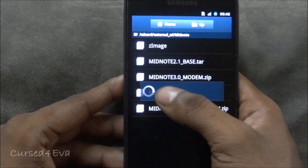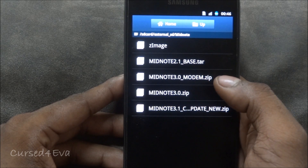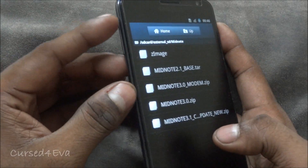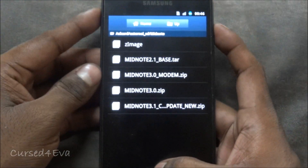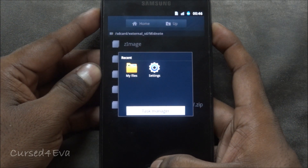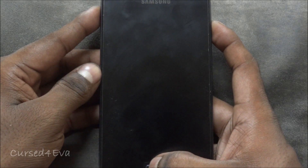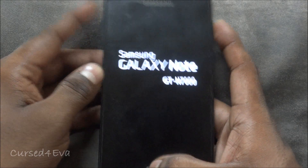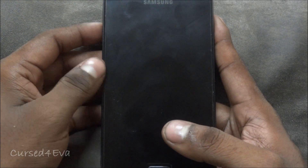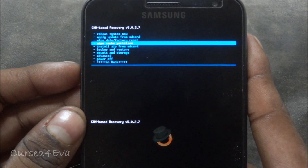Links one, two, three, four, five — I've saved them under a folder. You need to download these five files, and once you've done that go ahead and hit Volume Up, Power, and Home and hold it till the phone reboots. Once you see 'Samsung Galaxy Note' written on screen you can let go of those three keys. Now you will boot back into ClockworkMod Recovery.